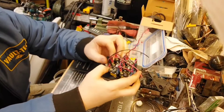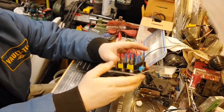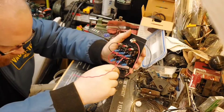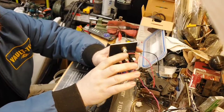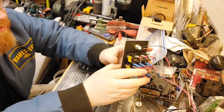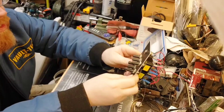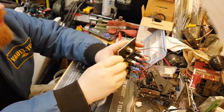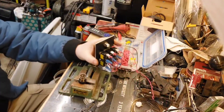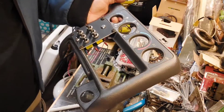I also did a red jumper sending power to all six toggle switches on the power side, exactly as labeled. That way when I go to install this in the car, I can choose which loads to control through which relays — and they don't even necessarily have to control relays. I could run fairly low amperage stuff directly, like my GPS, which might be powered straight from one of these switches instead of going through a relay since it's not even an amp anyway. Time to get it in the car, but I still need mounting holes, so I'll chuck this up in my vise and make some mounting holes. Got it mounted up with a couple of screws — nice and solid, very satisfying clickiness.